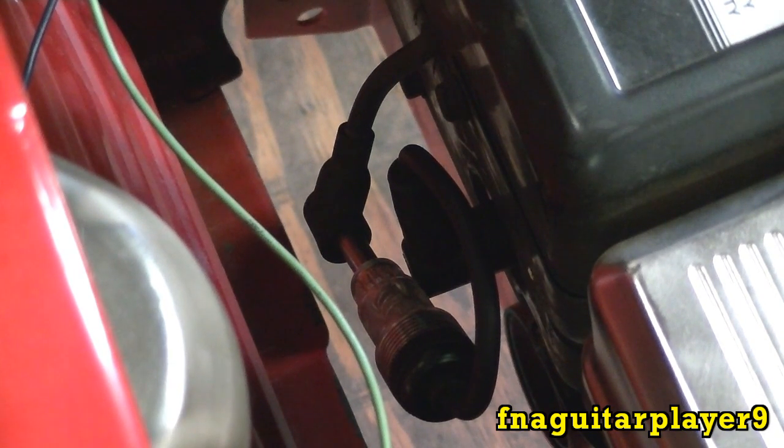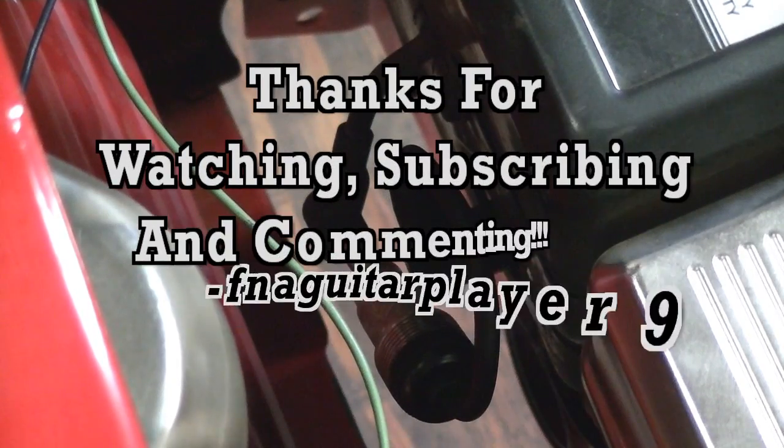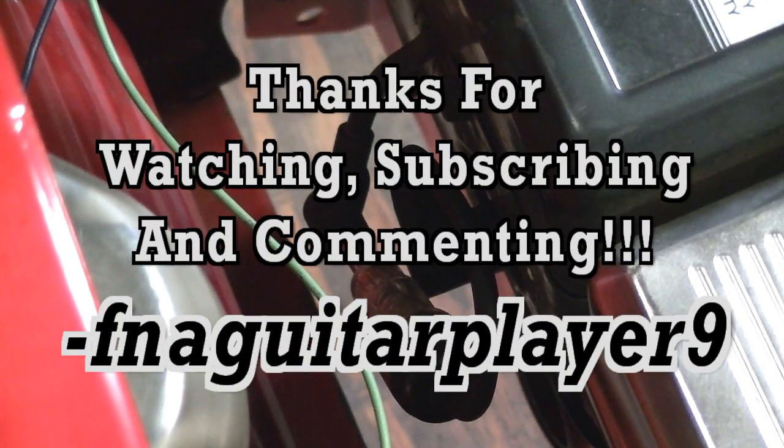I just turned the key off to show that when it's not sparking, it quits running and quits lighting up. Anyway, I just wanted to show you a few other ways of testing for spark. If that wasn't a constant firing on the light, you'd know the plug is fouled or misfiring. But it seemed pretty consistent once it was running, so it's got a pretty good spark and it's good to go. I finally decided to pick up a couple of these inline checkers after people recommended them. If you've got any questions or comments, leave them below. Thanks for watching, catch you on the next one.